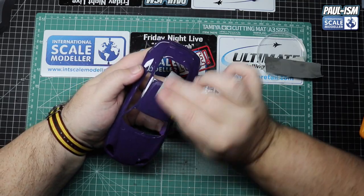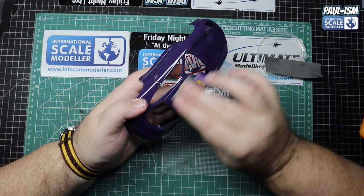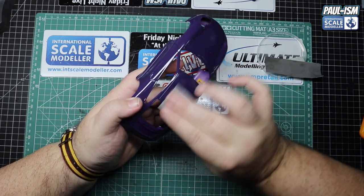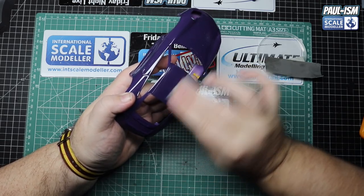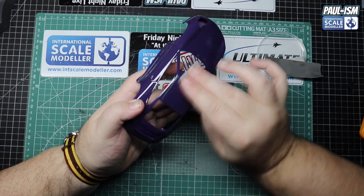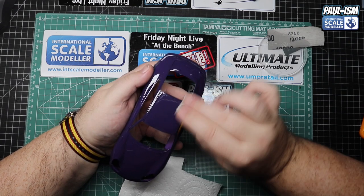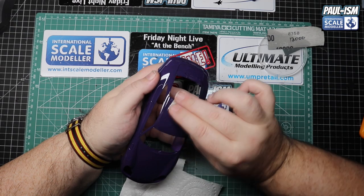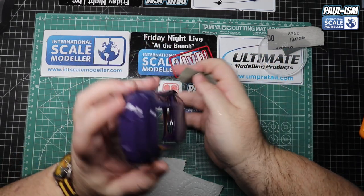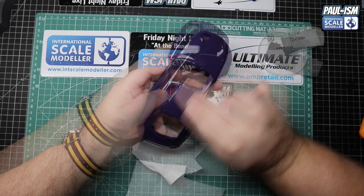So we're just going to lightly sand with each grit, working our way through until we clear everything that's a flaw, basically. All we've got is several spots of dust. There's no runs, there's no orange peel, nothing. So fairly straightforward to take care of. So we go through with the 6,000, then the 8,000. We're just doing back and forth motions. Keep it wet all the time, a bit of clean water. And just keep checking. I just want to see this slowly diminish the dust spot.